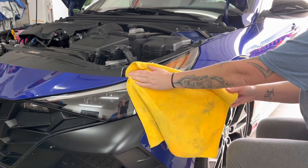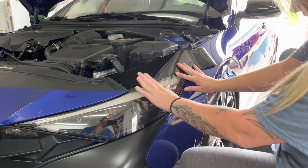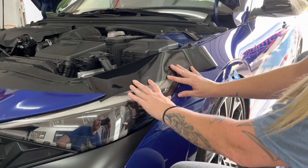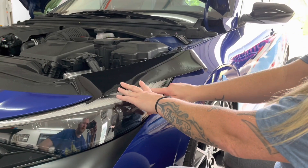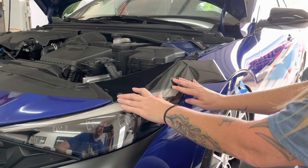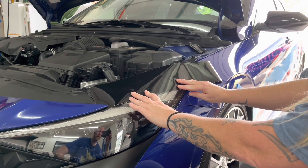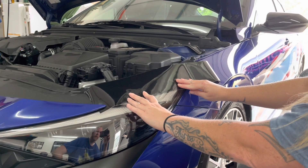For my car, I chose to go with 3M gloss black vinyl. To begin laying the vinyl, cut an 18-inch strip of vinyl from the roll. Align the straight edge of the vinyl with the tip of the front bumper. The vinyl should be just below the tip of the front bumper, and then follow the black line located just above the daytime running light.